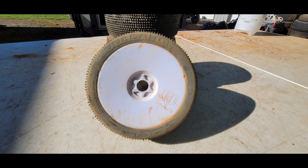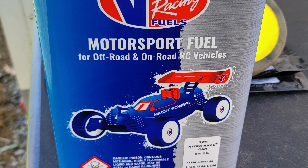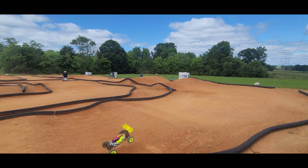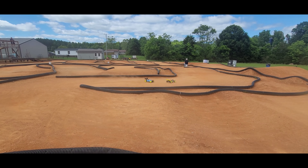For OGO tire compound, he's known for running the softest tire on the track most of the time — ultra soft — and gluing the foams helps prevent bowing. If the track gets really abrasive and temperature goes over 85–90 degrees, he'll move to super soft or even soft. Going harder on the tire is a last resort for him. He only punches holes in the rims, not the tire or foam.